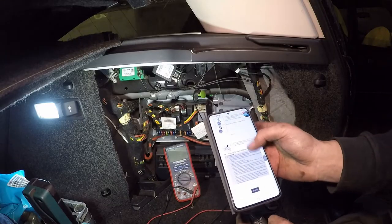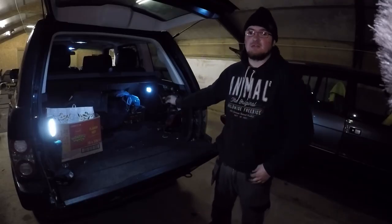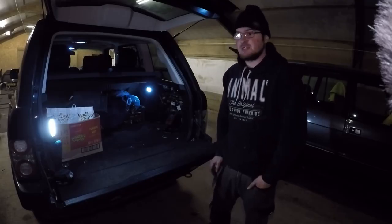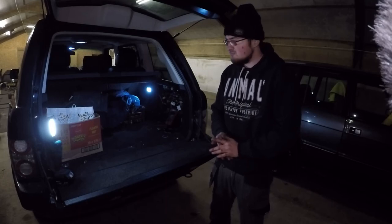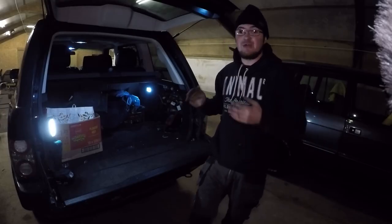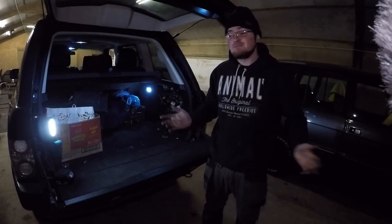I'm going to put this document in the description because it's a really handy one from Webasto. That's fixed! That's just the basics of testing the Telestart T91 module and testing if the wiring back to your heater works by bridging the permanent 12 volt to the switch 12 volt. For me it worked perfectly, and then just a simple reprogram procedure which again worked far too easily - same as when I reprogrammed a new key to the car. Not only do I now have heating in the car from the previous video, I've now also got remote heating. If this video has helped you, stick around, like the video, subscribe for plenty more content, and I'll see you next time for either a modification, an upgrade, maintenance or another repair. I've been Jordan - cheers!